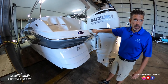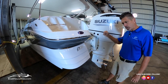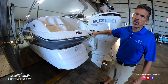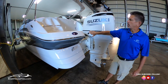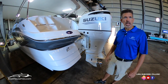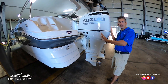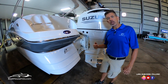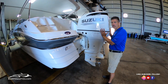It's no longer trying to pick the boat up; it's now pushing you forward, which is going to improve the performance and fuel economy of your boat. That's why the three-second theory is what we call the sweet spot. Always start out all the way down in negative trim, put your boat in gear, go to full throttle to get up on plane, bring it back to cruising speed, then hold the button 1001, 1002, 1003. That's typically a good running spot. You will typically pick up another 100 to 200 RPM more just by changing the angle of the engine, giving you a little more speed without more throttle — improving efficiency and performance.